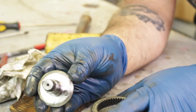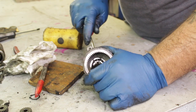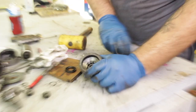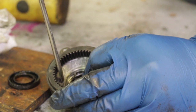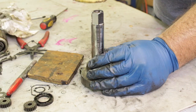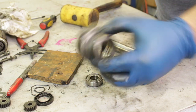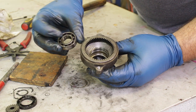If you're having trouble with this, take the time and heat it up with a heat gun. Next, pop out the small oil seal. Underneath you'll have a small triangular metal clip, and right past that you'll have the bearing. To remove the bearing, take a socket that was the same size as the inner race and give it a few light taps — this should come out very easily. If you're having issues, heat it up with a heat gun for about 10 minutes beforehand and it should fall right out.